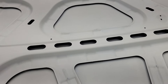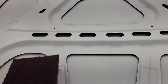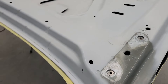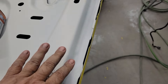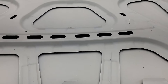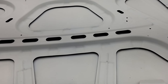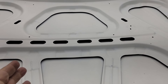Everything's been cleaned, Scotch-Brited, and sanded. I'll put on a pair of gloves now. It's already been outline taped — everything's been nicely taped around here — so I'm painting just the inside edges of the hood. Later when I flip it over I'll back-tape it for a nice edge. We're going to spray sealer on here, then base coat, then clear. But first, before we paint, I'll use a tack cloth.